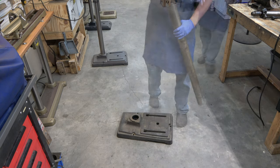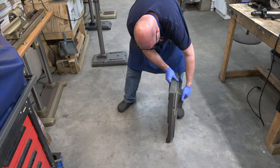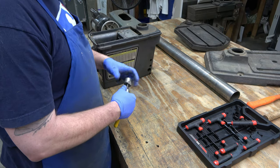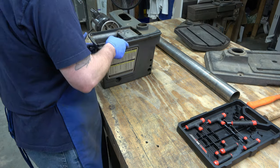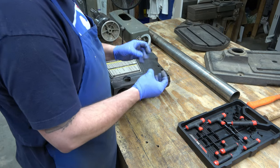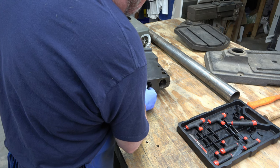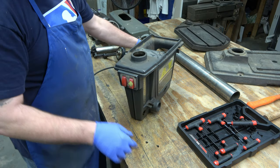On the Gen 4s, both the standard and the commercial, they stopped using the shoe that's normally on the inside of the base, so that screw goes all the way to the column. We're going to go ahead and remove the head lock — there's the nut and the barrel. Those yellow plastic handle covers can be slid off of the handle. I'm going to go ahead and pull that bulb out — it's an incandescent bulb. I always use LED bulbs; I can get them really white and really bright, and I prefer them over an incandescent bulb.